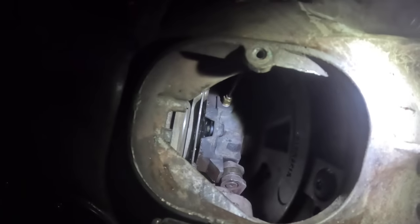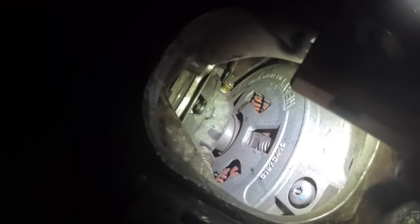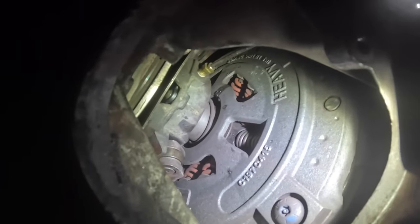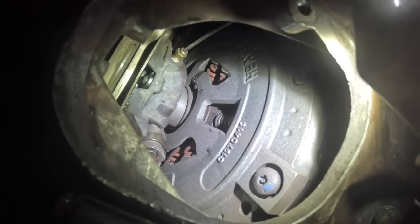So what you want to do if you're pulling this clutch out: go to the open clutch position with the software. That'll shove that throwout bearing all the way back and take the tension off the pressure plate, which allows the clutch disc to move freely on the input shaft. Then there are some holes - you can see one right there - and you take some 7/16" by 1-3/4" coarse-threaded bolts, thread them in. Those are the shipping bolts. Rotate the crankshaft around and put all four shipping bolts in and tighten them up. That'll keep the clutch caged when you disassemble it.